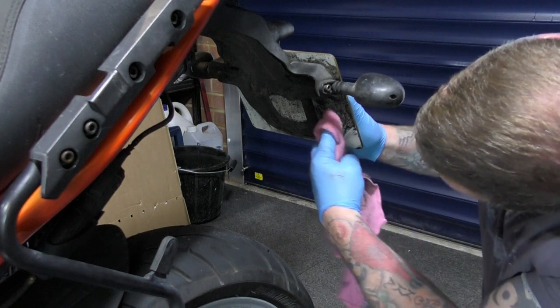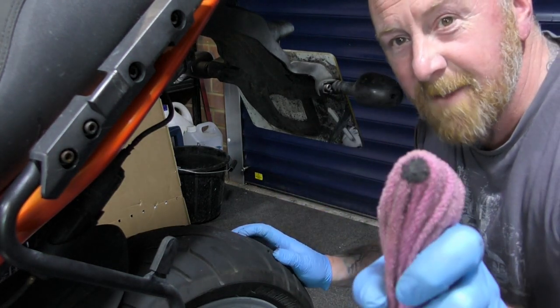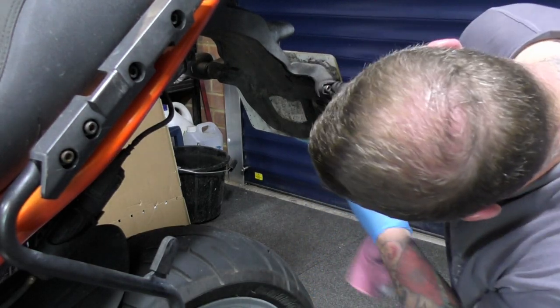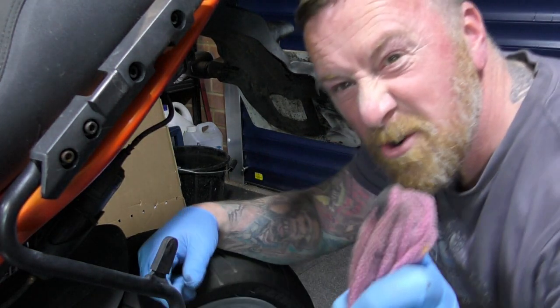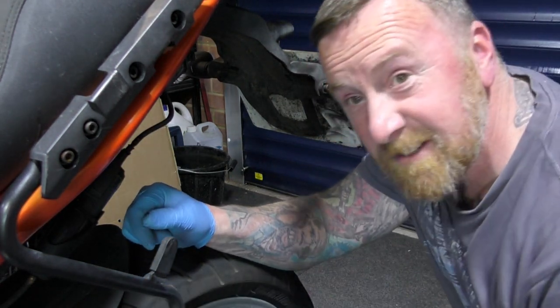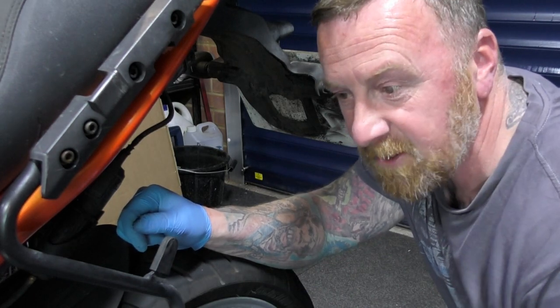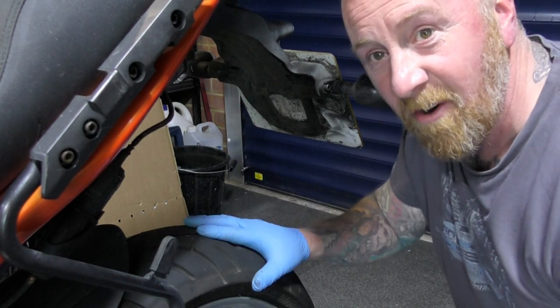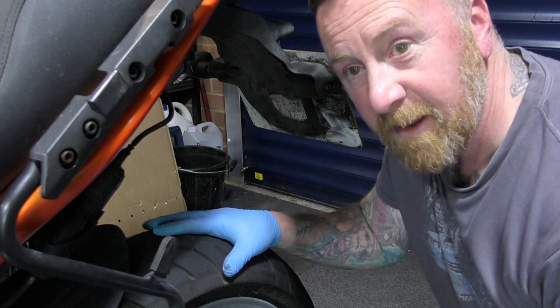Look at that registration plate. That is from the Scott Oiler. You see that? Look at that. Slippy, crappy oil that flicks up from an overactive Scott Oiler. I mean, it's put on, I don't know, 1 to 5, it's on 4 or 5, I don't know. And then eventually it gets onto the side of your tyre. And this will have you off the bike.